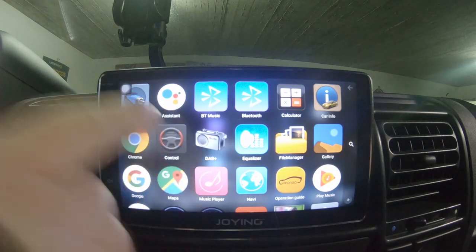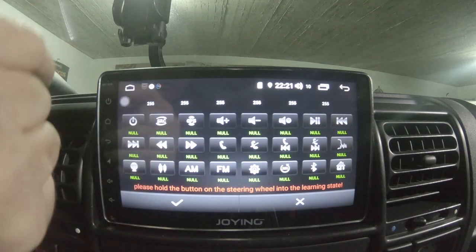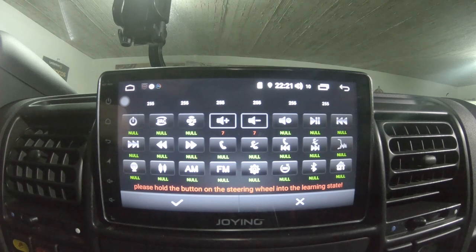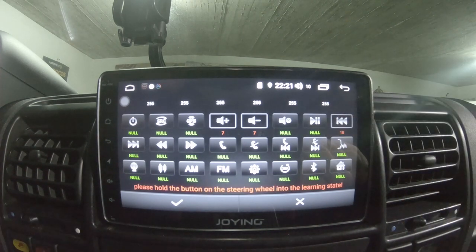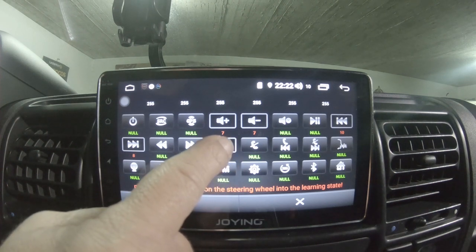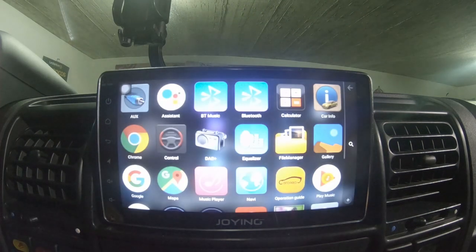Let's put this all together and see the steering wheel controls working for the first time in 14 years. How do you program the steering wheel controls into this head unit? You go to the control app with the steering wheel logo, and you'll see all the possible assignments. Our steering wheel controls only have 5 buttons, so we can assign 5 functions. I press volume up — assigned. Volume down — assigned. Skip track back — done. Skip track forward — done. And the last one: answer the phone — done. Here we have our 5 functions assigned. You press the check mark and all functions are working.